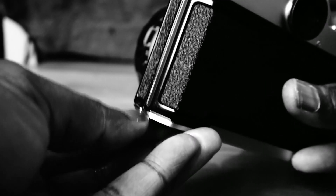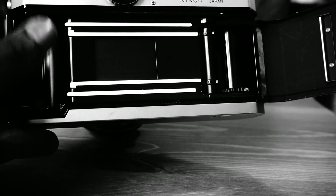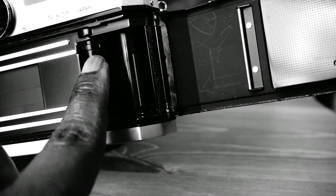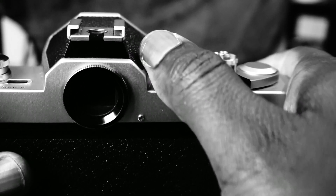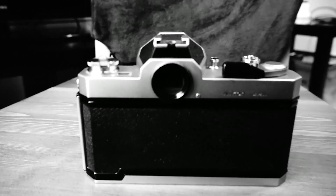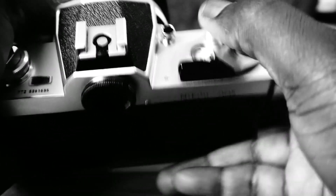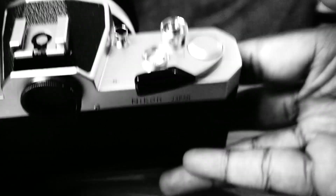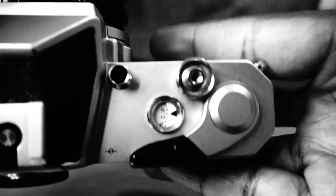Loading film into this camera is very easy. There is a latch at the bottom of the camera that releases the back door. The film roll is loaded on the left and the film passes through the spindle on the right as usual, making sure that the gears engage the sprockets. I normally wind once and close the back. Film loading on this camera is very secure and I've never had the problem of the film not latching like with some other cameras. The film is advanced via the wind crank, which feels very strong and secure. The frame counter window is right next to the wind crank and it resets every time the back is opened and closed.